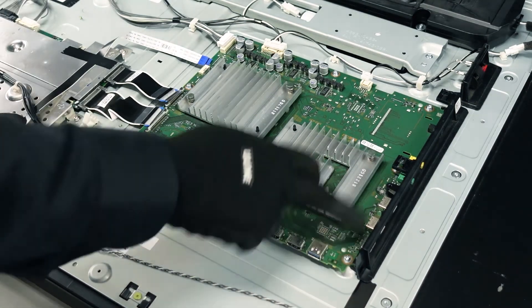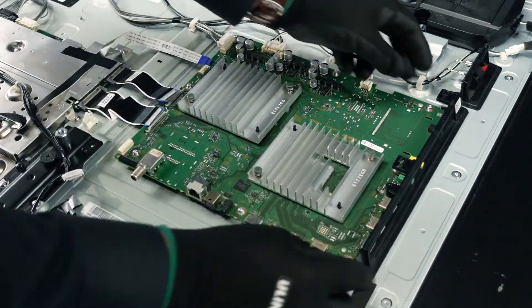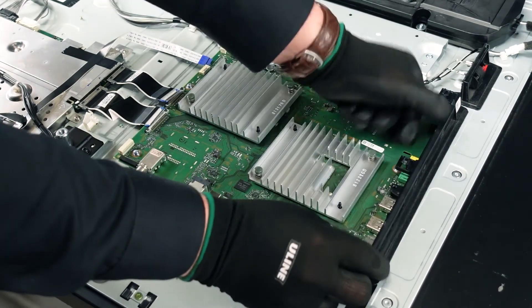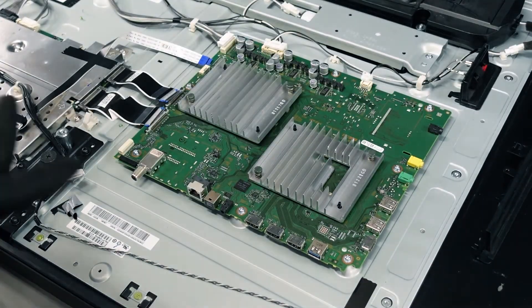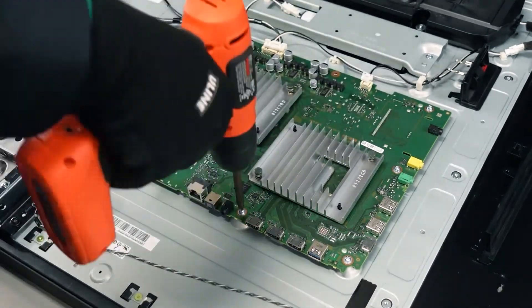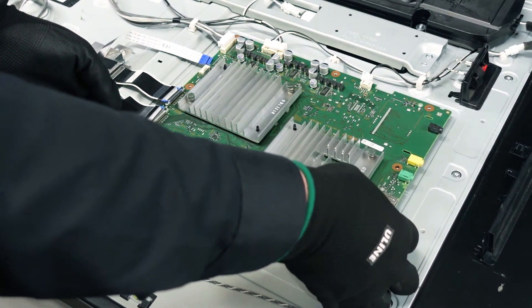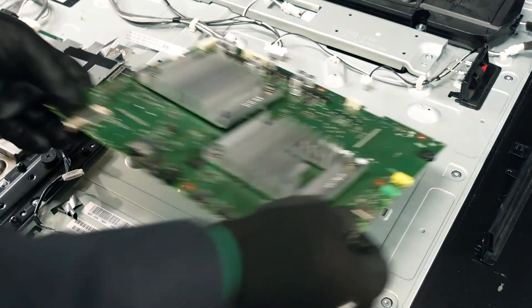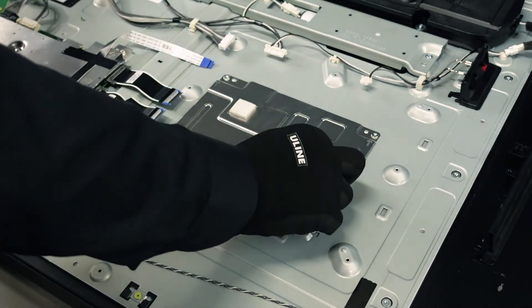At this point we can count the screws — three, four, five, six, seven, eight. To get to these we've got another plastic bracket along this edge, just like on the other side. Get some leverage behind it and it should slide directly out and away from the board — it's latched on by a couple of clips. Hard part's out of the way; now we just have these screws to remove. Be gentle lifting up — there's some resistance, so keep shimmying. Don't want to bend the board or break it, so shift it left to right to free up from that adhesive. You can see two spots right here and here — those are what's holding the back in place. And there's our main board.